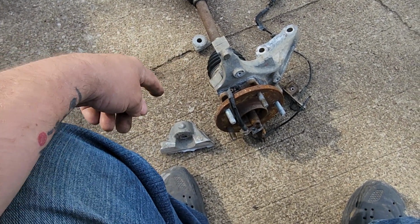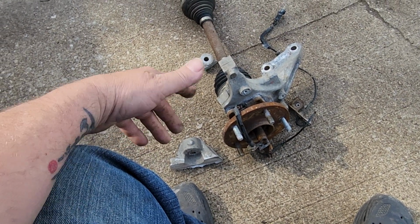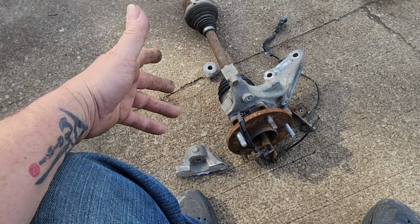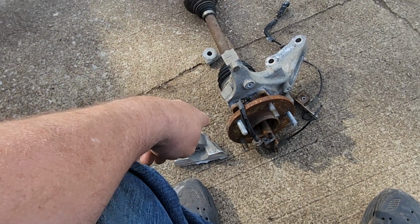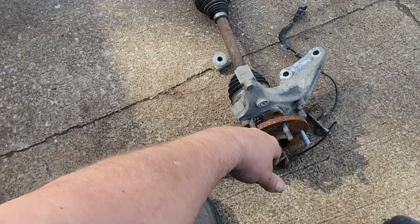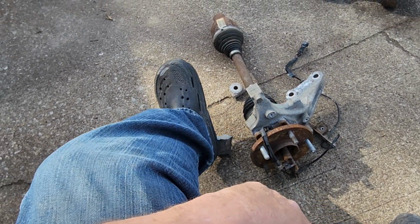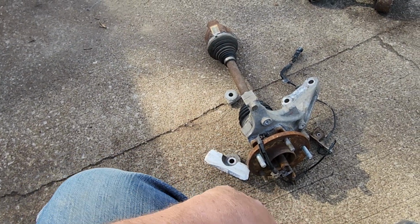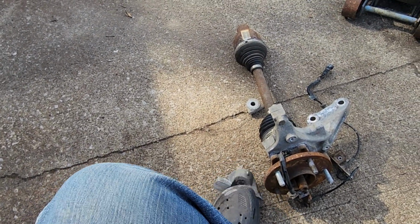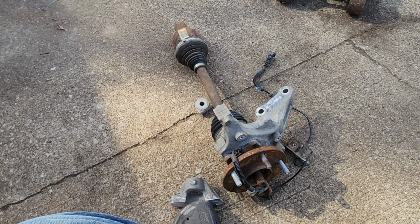Try not to worry about ruining the lower ball joint, which I wanted to keep because there was nothing wrong with it. They had to come off to get the steering knuckle off, because the drive shaft's got to come out before you can take the steering knuckle off the lower ball joint. You've got problem after problem. Everything's in everything else's way. So what did I do?